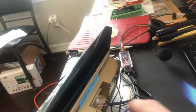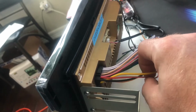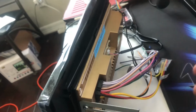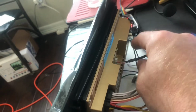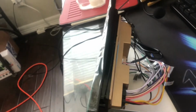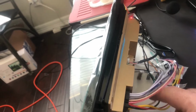So it's made to power up. I mean, it's got speaker wires. I won't hook the speaker wires up because I'm putting this in my dash. I'm not going to use it as a radio, but it's got speaker wires, 12 plus constant, 12 plus accessory, ground, and illumination. Those are the only wires I'll hook up. So it'll power up when the car powers up. It'll dim and brighten when I turn the headlights on. It's got a USB port. It's actually got a GPS antenna, so it'll be able to do its own GPS because Real Dash supports overlaying your dash into your gauge cluster. So that was great. I bought one of those.